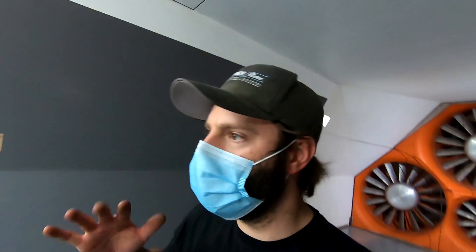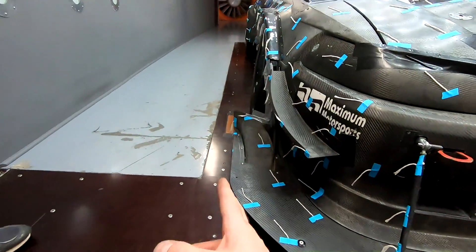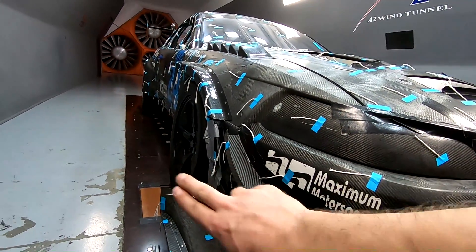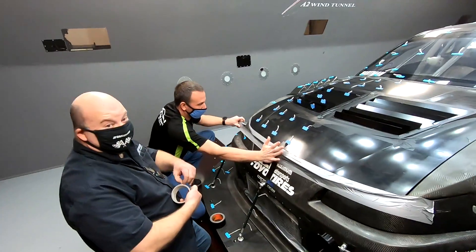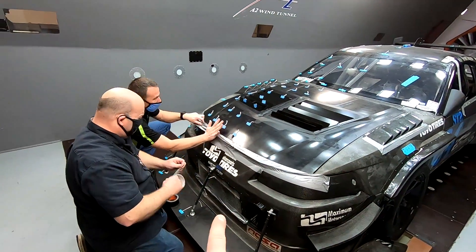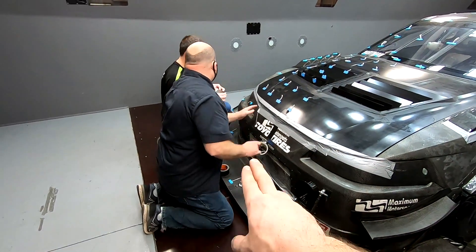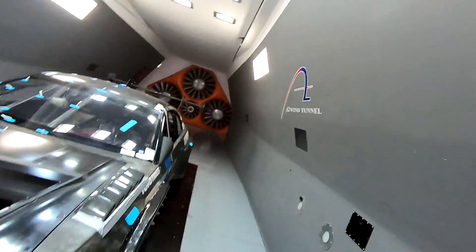We just finished all our wing angle change runs. We got rid of the side plate and flap because they were good downforce generators, but we want to see how they compare to just blocking the tire and throwing the air out sideways. Results were about expected on the front. We're now trying to gain downforce without adding drag — the RX louvers gave a better pressure drop across the radiator. With the better pressure drop you can tape up the grille to some extent and regain that drag and downforce, so it's kind of a win-win.